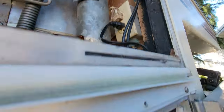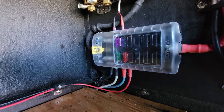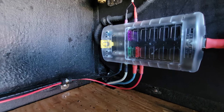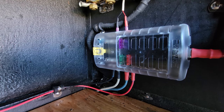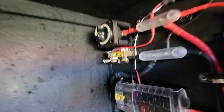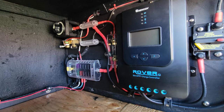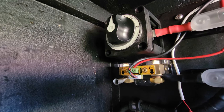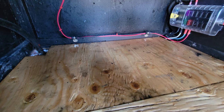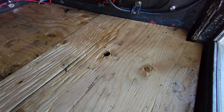The battery charger plugs into the fridge compartment outlet. I've also wired in a couple of circuits: a USB charger that goes through the wall to the interior of the camper, and I've temporarily wired the existing DC wires from the camper to a 30-amp fuse on the fuse block until I have time to rearrange things. I also wired in an LED light for the battery compartment so I have light when working in there. Now I'm ready to wire in the battery — I'll add 4-gauge lugs and mount the battery tray, but first I'll reinstall the factory camper tie-down.